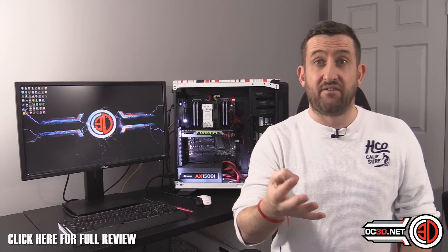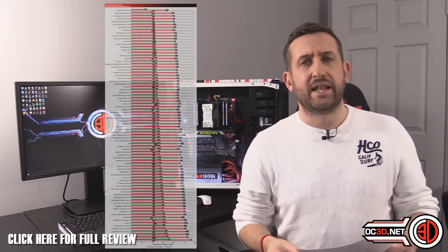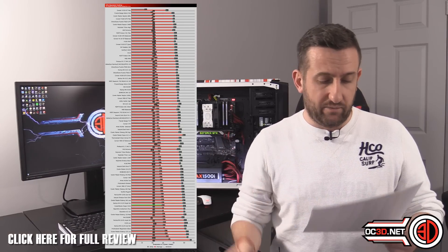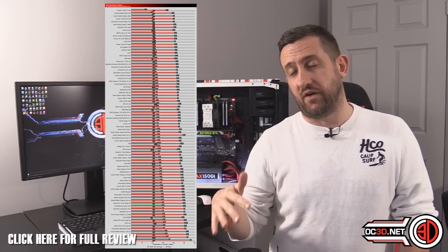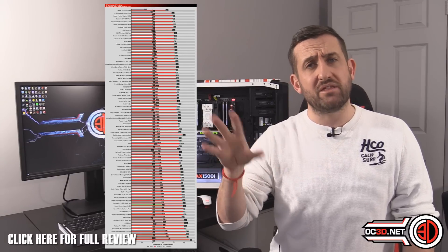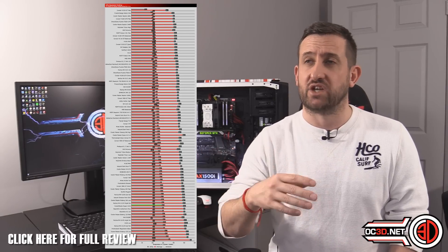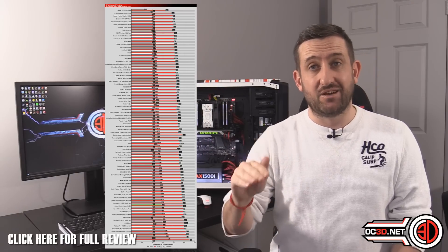It's also easier for you to understand that if it's running at maximum RPMs and you want to turn it back, temperatures will go up. Now I'll show you the complete graph for our testing. You can see all the coolers we've tested on the Overclock3D website. With our baseline test we actually do an undervolt — 'auto' means the voltage does what it wants and is always above what the CPU really needs. With the undervolt we've been able to get our CPU, a 3960X, running at stock at 1.1 volts, dropping heat requirements right down.